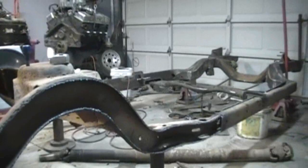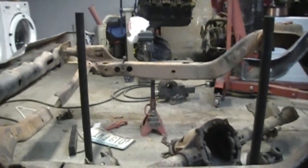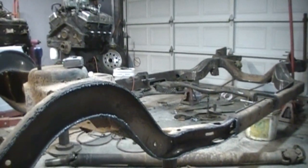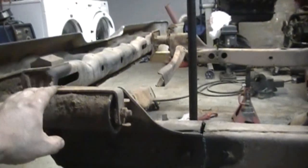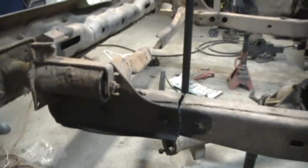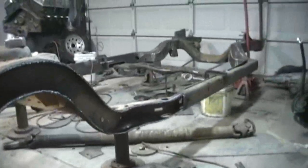What I'm thinking is: if this car front end doesn't bend, I could probably just keep swapping the bodies — just whacking these frame rails off, getting new pieces, and putting them on. Because these cars — this is a '76 Impala — you can stick these frames under every Chevy Impala, Caprice, and practically every Pontiac and Oldsmobile. They're all the same body size from '71 to '76. You see how these stick up? They have special indentations in the trunk floor to cover that, but guys just cut it out. You can put a '71 Impala on this frame, no problem.